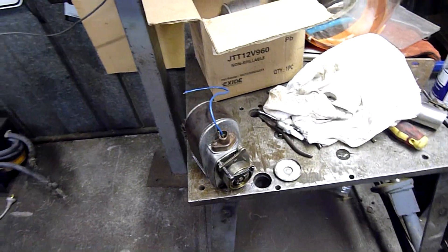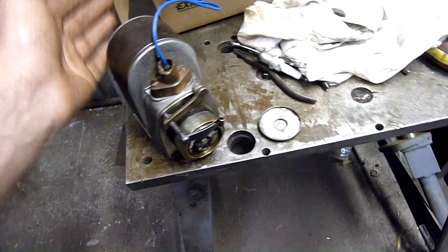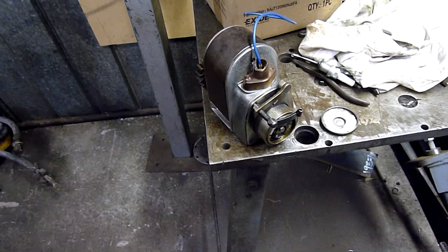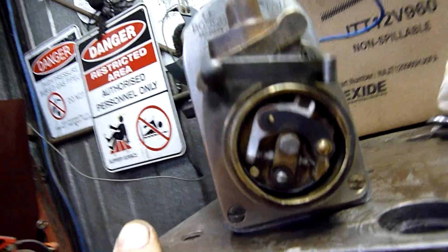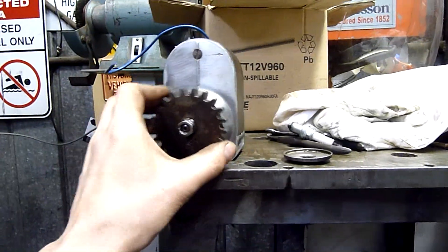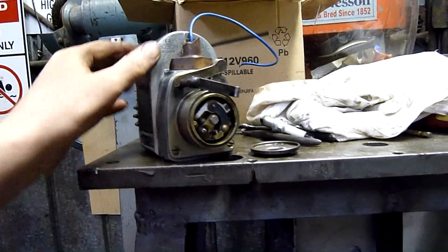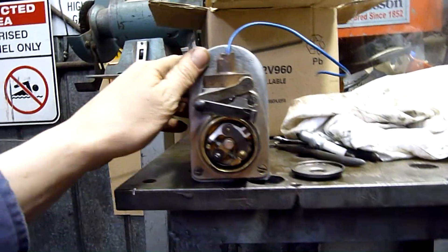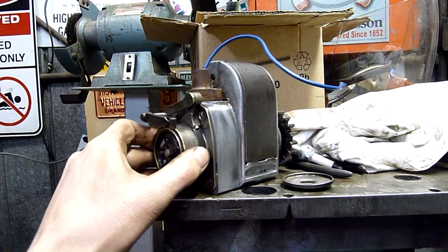After a bit of a clean up, this one shows a bit more promise than the ZE1. I am getting a spark off the output to ground but not much. I even put my hand across it, spun it over, and it's enough to give you a little tickle but that's about it — not very strong. You get a nice pop across the points, so again I'm guessing the condenser might be bad. I've gapped the points out a bit and it improved things a tiny bit, but overall the rest of it seems to be alright.